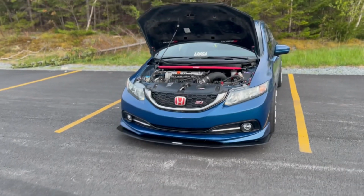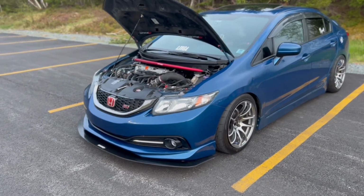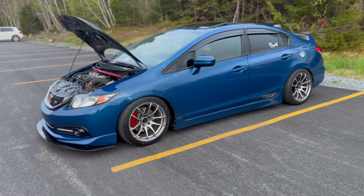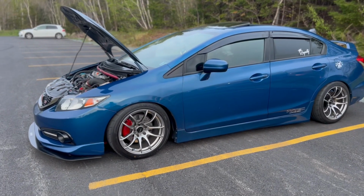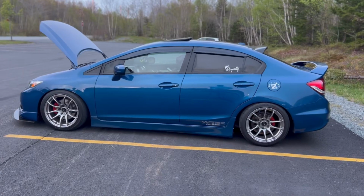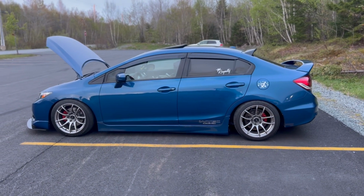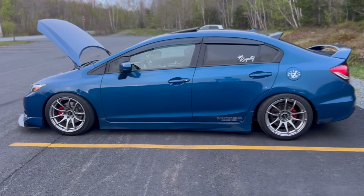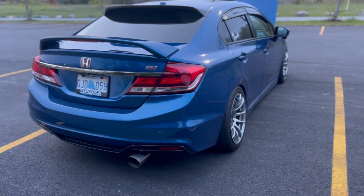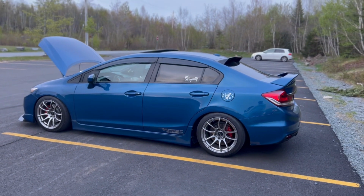Like the camber adjustment also, I need to mention this. On the front of the car, there's a camber adjustment for the front. But in the rear, there is no camber adjustment, so you have to buy camber arms. I don't even remember, but they're cheap. It's a reasonable price. It's not a high expensive brand like K-Tune camber arms, but they get the job done. I just got an alignment, so they didn't have any issue tightening these. And I also store the car in the winter time. I'm running the Yonaka exhaust. So yeah, 2 years of driving, you know, it's perfect.